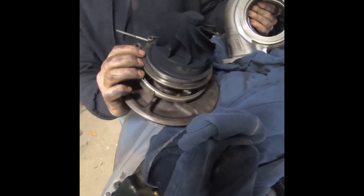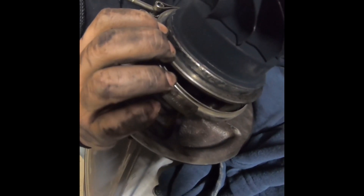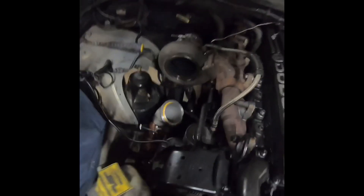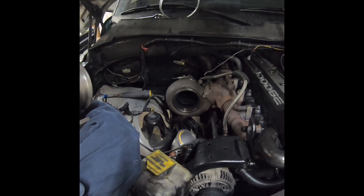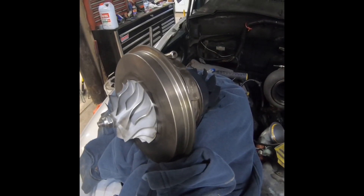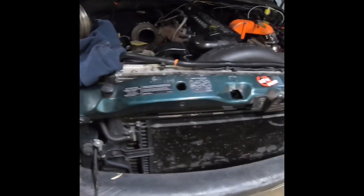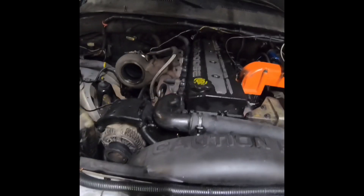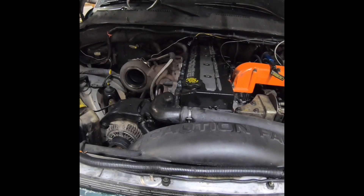The diameter of this exhaust housing is too big — it won't even go over the wheel. With the size of that exhaust housing, we drove the truck last night and it just won't spool. It probably would with nitrous, but it needs to get the small exhaust housing on. He's gonna have his brother order one and then they're just gonna switch them out. It gets like 40 pounds of boost and that's all the fuel it has — it simply can't do it.